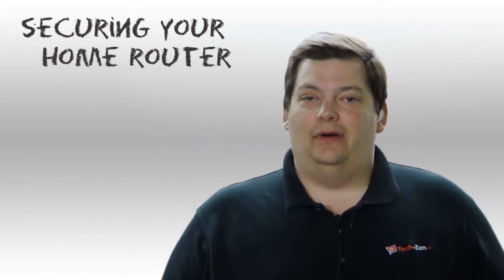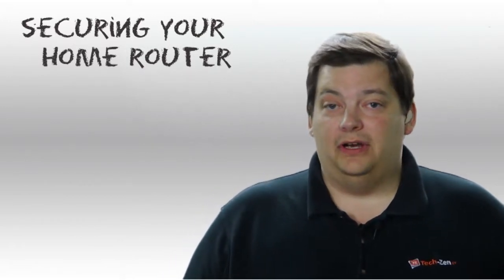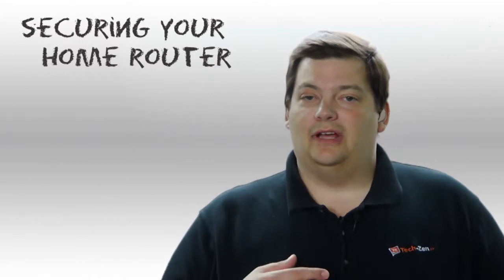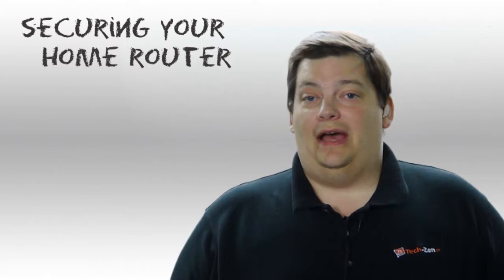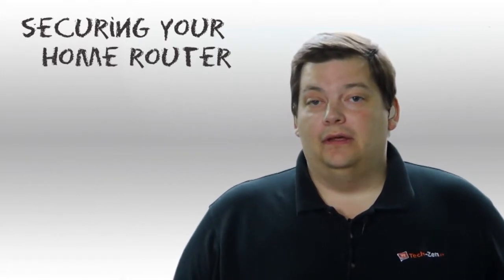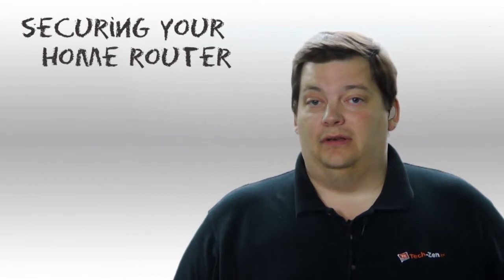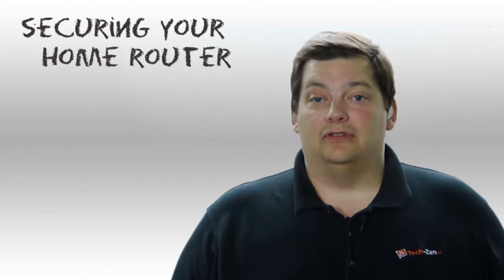Now, it's not a big deal that people are using your internet to get out, although it's technically against the law to use somebody else's internet. If you didn't secure it, you didn't do your best effort to protect yourself, so I don't know if there would be any prosecution. But there's a couple other things. Your computers are on that same network, which means if somebody wants to hack into you, they can get on your network and look around, and you never even know it, and get into your machine, and give you malware, take your data. And a lot of machines are installed with open shares, so you can pull things off your machine. You could be open sharing things between yourself and the house, thinking you're safe, but you're not.